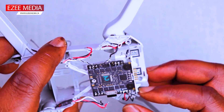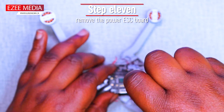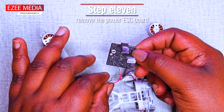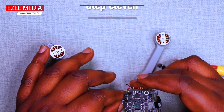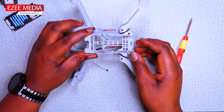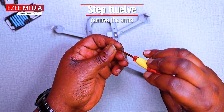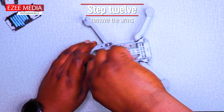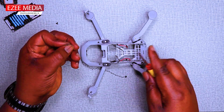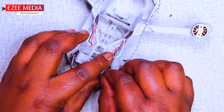You're gonna need to know exactly — or mark — where you take the wires from, the blue, the black and white, to know exactly where they also go from, so when you're soldering them back it's going to be very easy for you. Next are the arms and you just have to unscrew the arms and take them out. It's pretty easy now that you've unsoldered the wires, so when you take out the arms you can easily just slide them through the various holes.